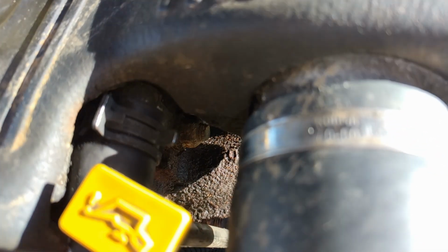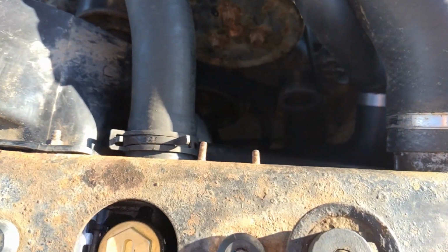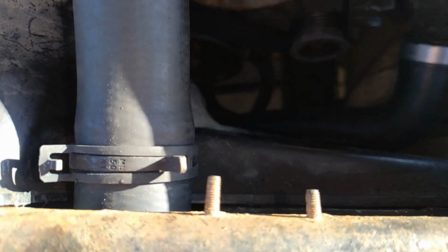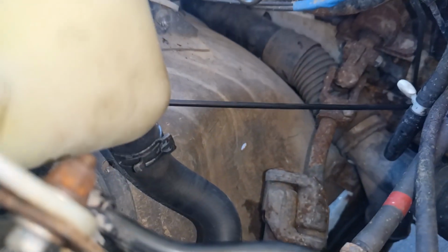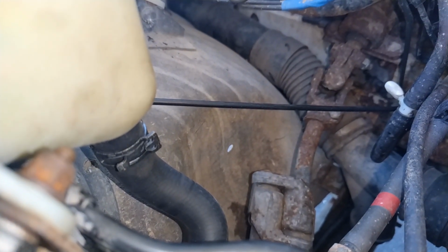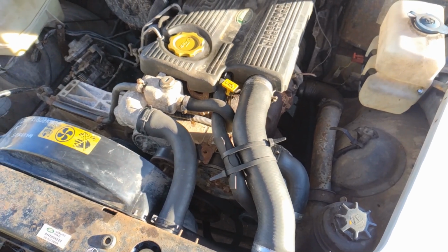So you'll see all the pipes I've fitted have now got constant tension hose clamps, and just a few of the little ones there, like the Y-shaped piece from the header tank to the top of the radiator and to the thermostat housing, and then also the water pump bypass still have worm drive hose clips on them. But I've got a stock of constant tension clamps, and I think I'll be using them for all my coolant pipes in the future.